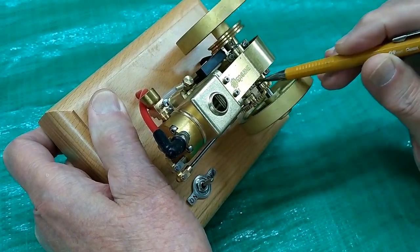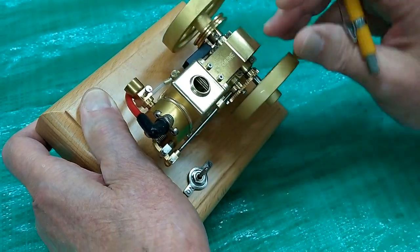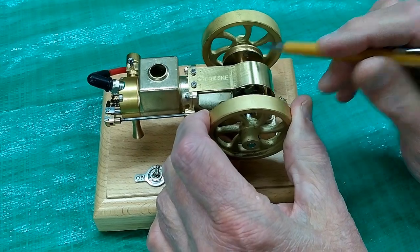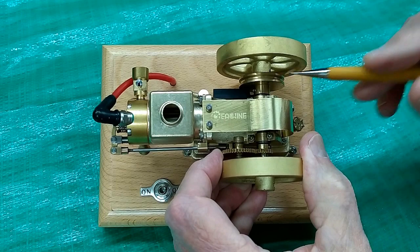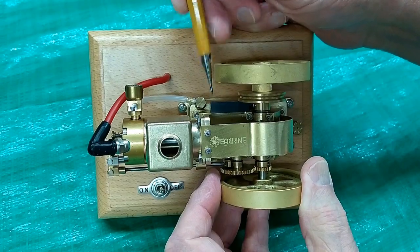The bearing caps are put on here at an angle that's a little bit different. We now have this little guard that goes over the crankshaft and the connecting rod. The magnet for the hall effect sensor is in the back of this pulley, and this pulley can also be used for an O-ring or drive belt to some external device. The hall effect sensor is here.